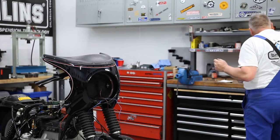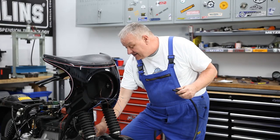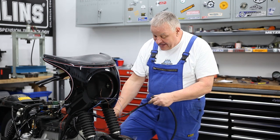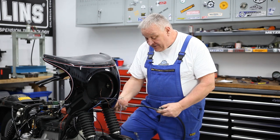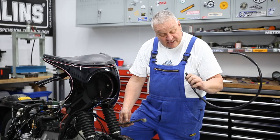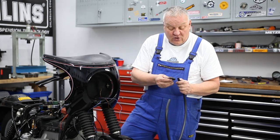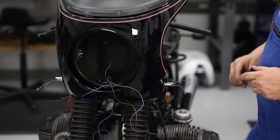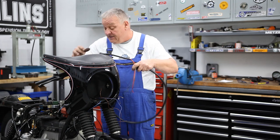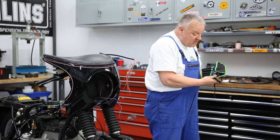Now we can go ahead and enlarge the holes. We have this wiring conduit in a variety of sizes, and I've determined 12 millimeter is probably just about perfect — it's the same size as here, and there's enough room to add these additional wires as well. The original conduit is really hard and brittle, so we're going to replace it. I want to make the hole in this grommet the correct size so that it'll fit, and the other grommet also has to be sized appropriately for this conduit.